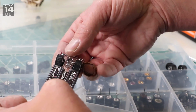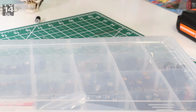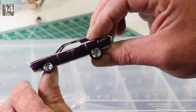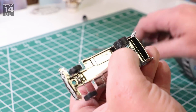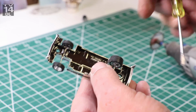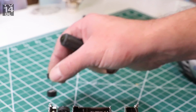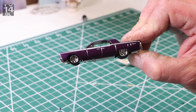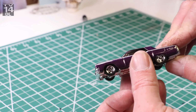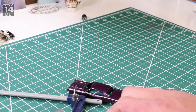They're pretty common on, I believe the gassers use them, mainly the '55. So it's bigger in the back as far as a wider tire, and then like a 50 series and a 70 series tires. Essentially, you can kind of see there. The unfortunate issue is, of course, the wheels don't fit as usual. But I hacked those out with a Dremel tool to make them fit just a little bit on each end where the wheel well opening is, and it worked out fine.